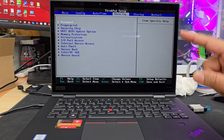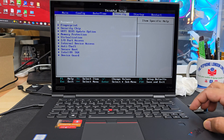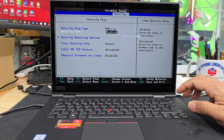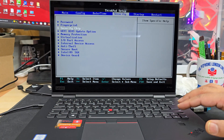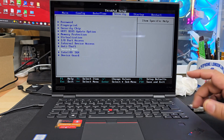If you'd like to install Windows 11, go to Security Chip, which is TPM. Hit Enter. As you can see, TPM 2.0 version is enabled — make sure that is enabled. Then press ESC to go back to the main menu, and from there go to Secure Boot and hit Enter.